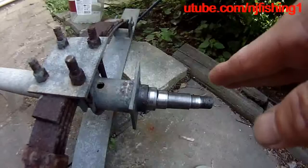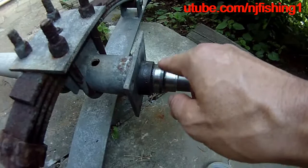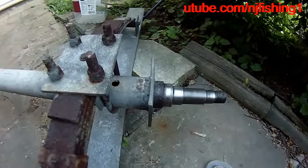This is the right-hand side trailer spindle. You can see it's in very nice condition — the castle nut came out easily, the bearings are very smooth, there is no damage at all. There was no cotter pin or washer behind the castle nut either, so it was easily removed.